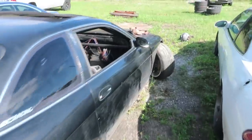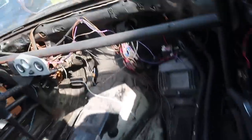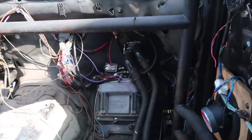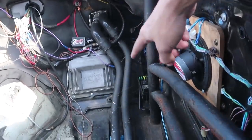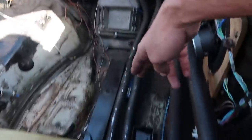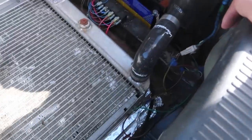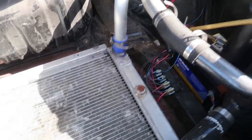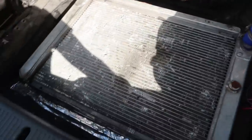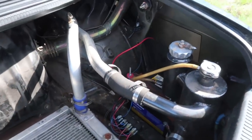I'm going to show you how he did his SE — this is Arthur's party car. I don't know if you remember it from before; he let me drive it. It's a turbo LS and it's sick. He recently did his radiator to the back because he was having a lot of cooling issues. He ran the lines like this — mine will just go straight down under the seat, over here to the back. Let me open the trunk — it comes through here, there's a swirl pot, and then back to the radiator. It's a very functional rear mount, which is exactly what I'm looking for.